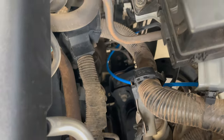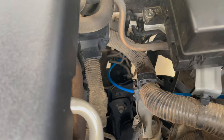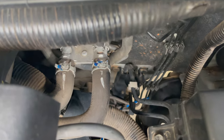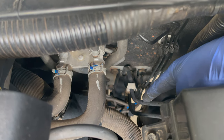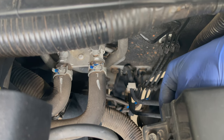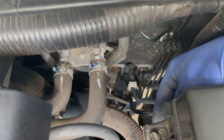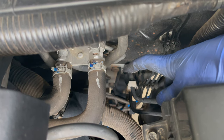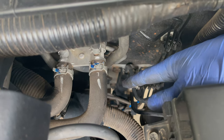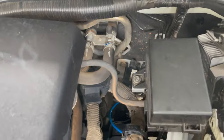I'm not sure if you can see down there — we've got a lot of moving parts down here, obviously, upper control arm. What I'm going to do is, once I've got the split tube conduit all fixed onto the normal piping, I'm going to cable tie along these brake lines and, as much as I can follow them, take the safest route all the way down to the back of the car to where the diff breather is for the rear. I'll show you under the car in a moment.